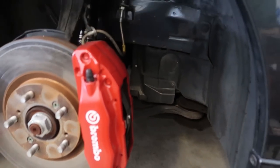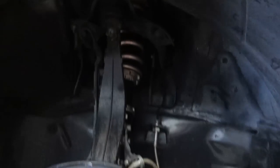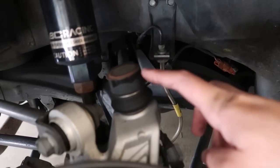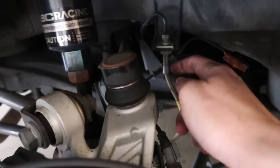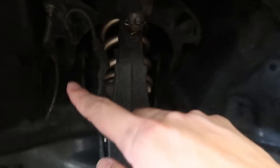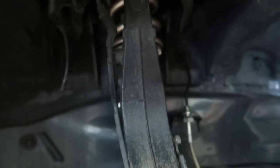The paint is holding up pretty good — just not the best in spots. You can see out there the fronts don't have camber kits and same with the rears. The rear camber kit is literally just this bolt right here — should be a 17mm under here and another 17mm in there. That's it. The front camber kits are super easy to install — take out the cotter pin, 17mm, two bolts up top, and one for the ABS cable.